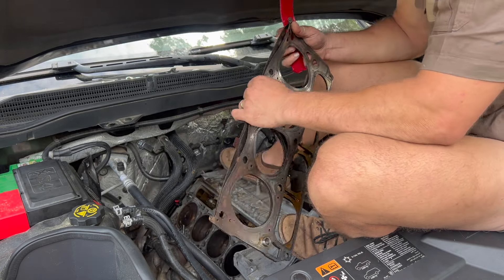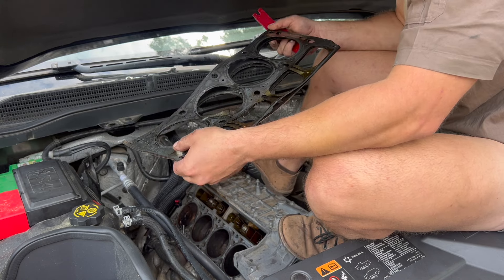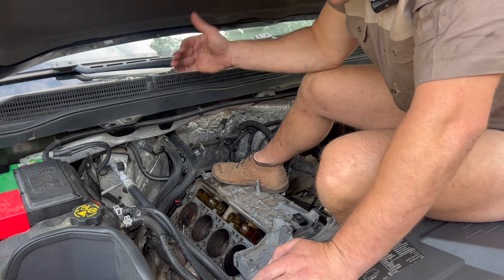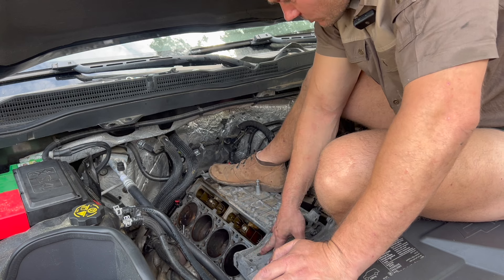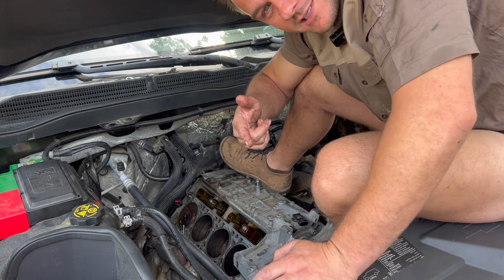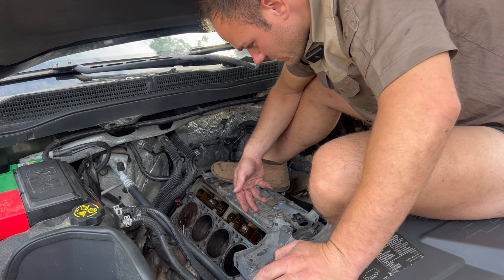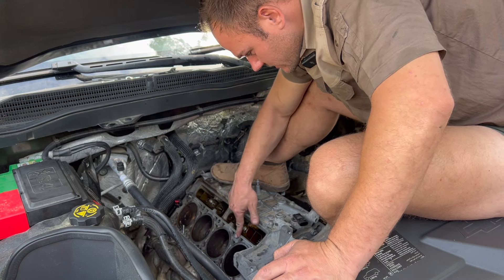We're out — good thing we're replacing it. Save the dowel pin — this helps to guide the cylinder head back into the block so definitely hold onto that. On the passenger side I kept the manifold in, just loosened it from the cylinder head, and the alternator bracket didn't need to come off either — there was enough space for the head to come right off. Now that the heads are off we've got access to the lifters. The pistons actually look pretty good — not a lot of carbon. I'm going to wipe them off and clean up the surface for the head gasket, which I'll show in the next video.